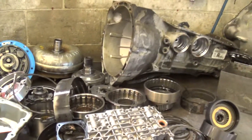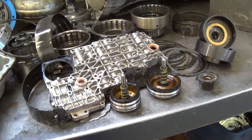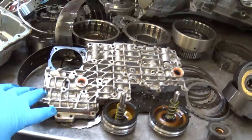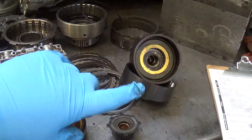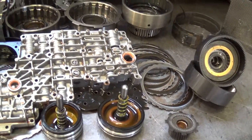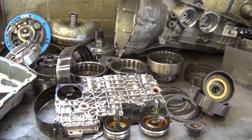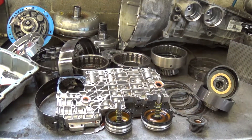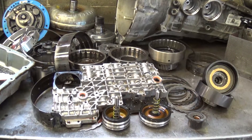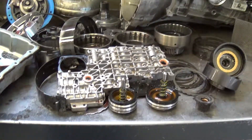So there you have a complete rebuild. We've got to repair the case assembly, replace the torque converter, install a complete master kit, replace all the bands, the servo pistons, overhaul the valve body with an upgrade kit to improve lubrication, and replace the sprag assembly. Of course all new clutches, gaskets, slip seals, and rings and seals. We'll do our patented hot flush hooked up to the cooler lines, which flushes the cooler lines, the cooler, and the radiator to get all the debris, contamination, and metal out of there. And it comes with a five-year, 100,000-mile warranty covering all parts and labor nationwide.